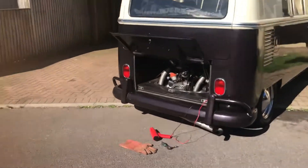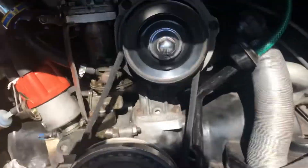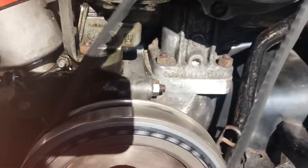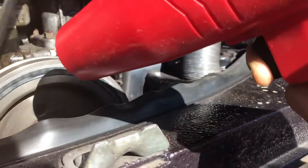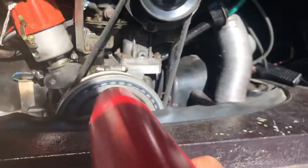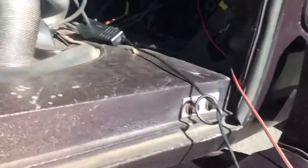Part two, trying to set the timing with my strobe light. I've got electronic ignition with no advance, so I think that affects things. For now I've set it on — it's so sunny it's hard to see — but it looks to me like it's on about 8 degrees before top dead centre at tick over. This is just a really cheap eBay timing light; it's connected to the battery and it's on number one.